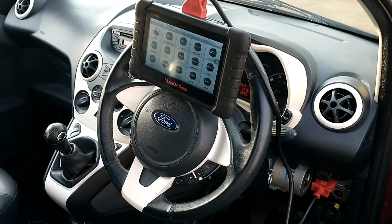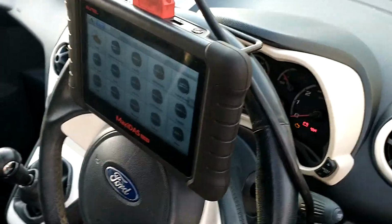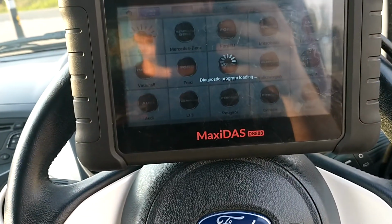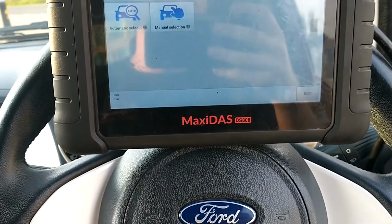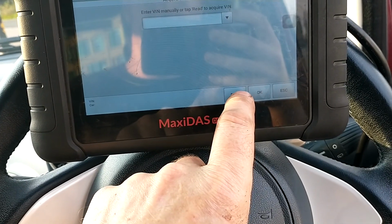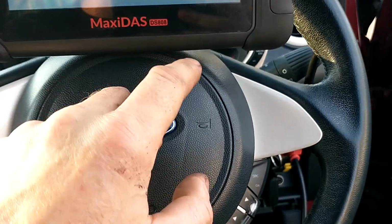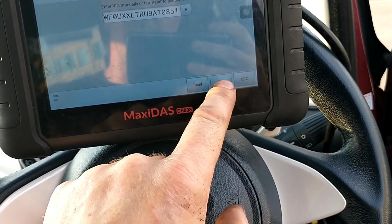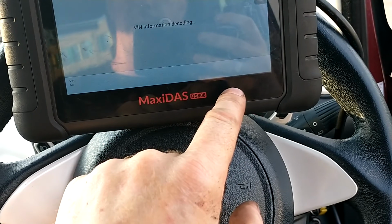We would then do a diagnostic test if you've got one of these, but if not, you could have the choice to get a mechanic to check it for you. We would do a diagnostic check before we test drive the car, and then another one after we've test driven it, because some people can wipe out their fault codes before you arrive to look at the car to buy it. So it's a good idea to check it again after you've test driven it, so if any faults are present, they would have come back.